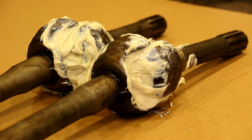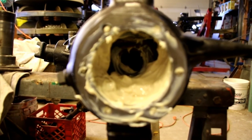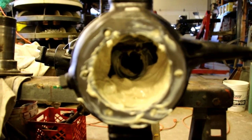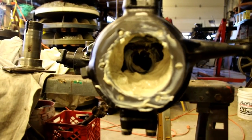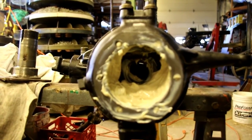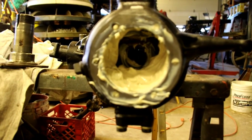Those joints are packed good and we're going to get them in the housing. Before slipping the axles in, I threw a bunch of lube in the knuckle and smeared it all around — it's much easier to do before the axle shaft goes in; you can just pour it into your hand and ease it in there. I've got both sides filled. Now I'm going to slide the axle shafts in, being careful of that interaxle seal — you don't want to slide it in fast. Feel your way through the interaxle seal carefully and then into the spider gears.